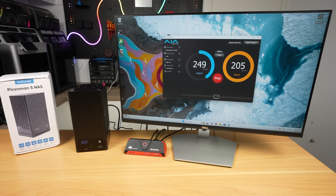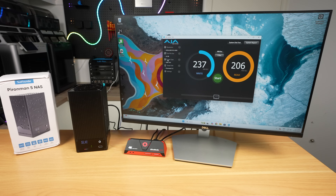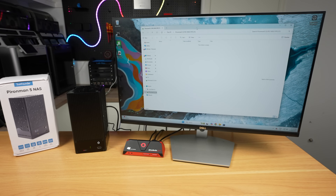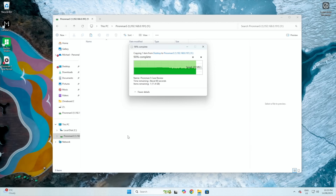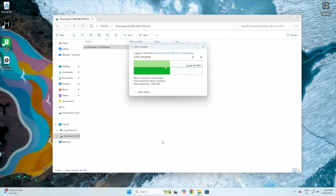Using an automated tester with a 1GB file, we get writes of a little over 240MBps and reads around 200. Stepping up to a 16GB file, we get similar writes of a little over 230MBps and reads just under 170. I then tried a real-world test copying a large 60GB video file to and from the NAS, getting an average write speed of around 260MBps with highs of nearly 280, and an average read speed also around 260MBps. So performance as a NAS is good, and speeds are what you'd expect from a 2.5GB network connection.